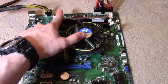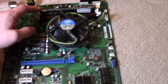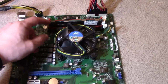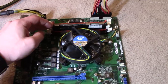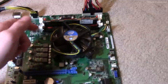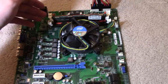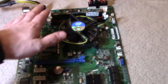I've got some DDR ECC memory to put in there, and you'll notice I've put it in the second slot. If you've ever wondered why motherboard manufacturers color the slots this way — they do it to tell you which channel is which, but also to tell you which ones to use for single-stick operation per channel. The memory channels are generally wired as a bus, and you want the memory at the very end of the bus so it acts as a termination. If you put it in the slot closer to the CPU, you have a bunch of wires hanging off the end, the signal will bounce back as a reflection, and this can cause stability issues. That's why they always ask you to put it as far away as possible — and it's pretty much the only thing I use motherboard manuals for anymore.